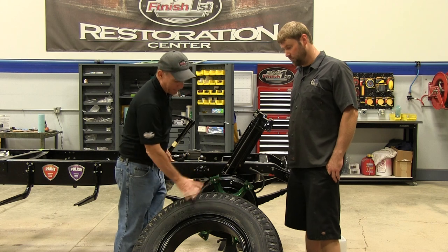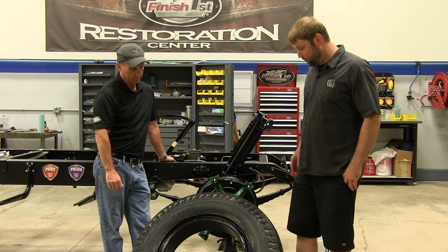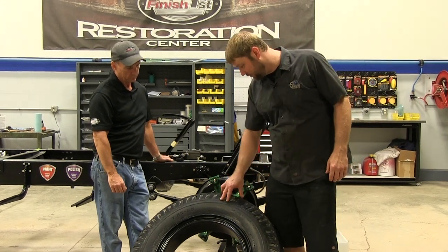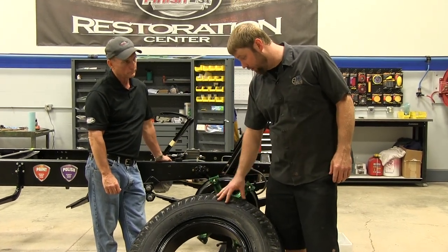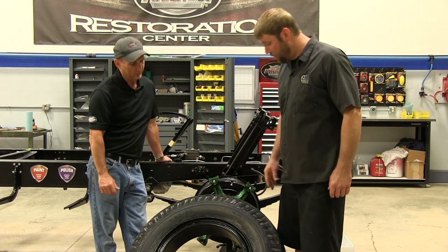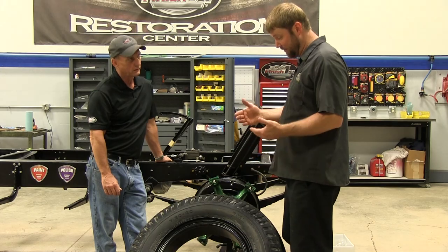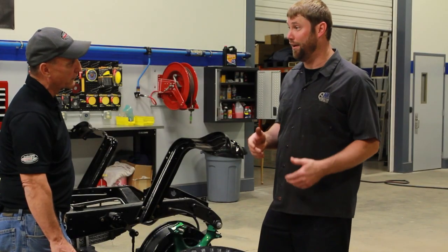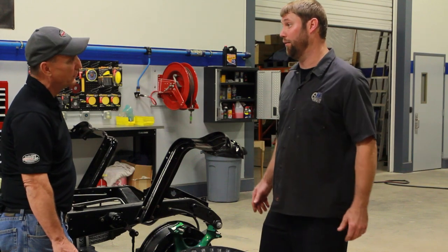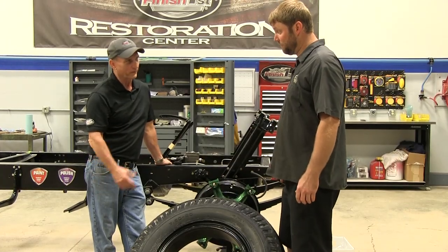While we did that, what did you have to do to work on these wheels and tires? Well, these tires and wheels — this setup is called a suicide rim. What they call the suicide rim is it's a two-piece rim, and the outside lip is just really small, and a lot of times they fly apart when you're airing them up.